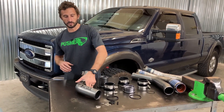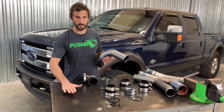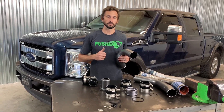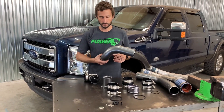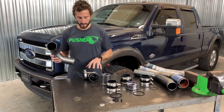If you're shopping for an aftermarket version, one thing you really want to make sure is that it has multiple bends. If it's just a single bend piece of pipe that would lay flat on a table, stay away from it. There's no geometric way to get from the intercooler outlet to the throttle valve with one bend without rubbing on something in the engine bay. You can see ours has a three-dimensional, kind of helical bend.